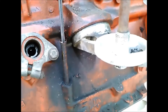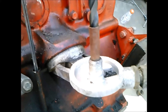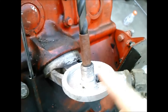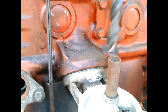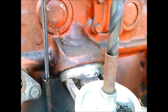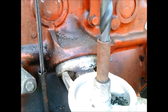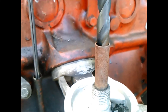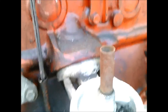Here's that same MGB engine with a late model spin-on adapter. This is really the best way to go with the MGB — just get one of these late model adapters and put your spin-on like the factory did. The point here is, the hole up the center in the factory arrangement is 7/16ths. This is a little small; I've seen these at a half inch, even at 9/16ths of an inch. But on the conservative side, and by direct measurement, this stock hole is 7/16ths.